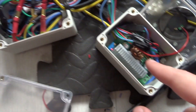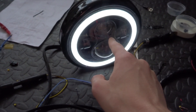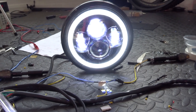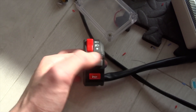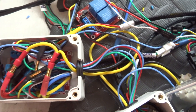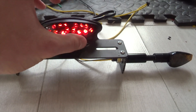The front and back indicator for each side are color-coordinated: blue is right, green is left. The front indicators run over to the front by the headlights with extenders. All of this is powered by thick yellow and black wires from the 12-volt converter via bullet connectors - one powers the indicators and the daytime running light, and the other goes directly to the two relays for the low beam and high beam. The handlebar switch itself has a two-position switch for the indicators and a three-position switch for the high beam, all braided up.